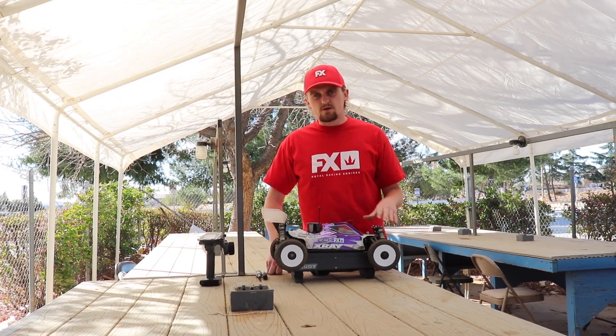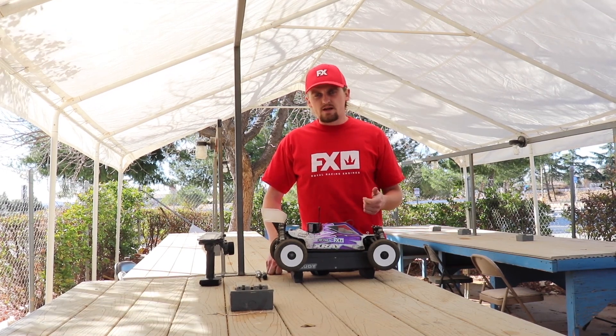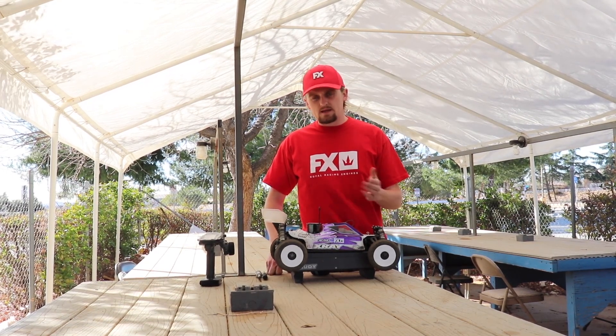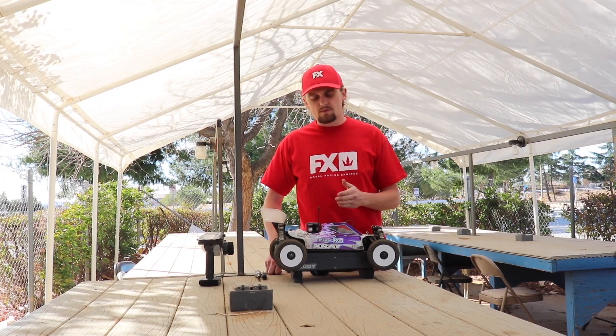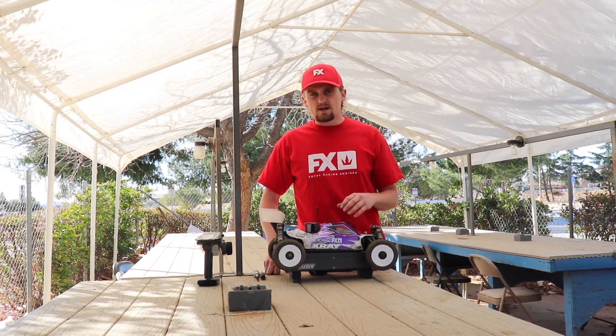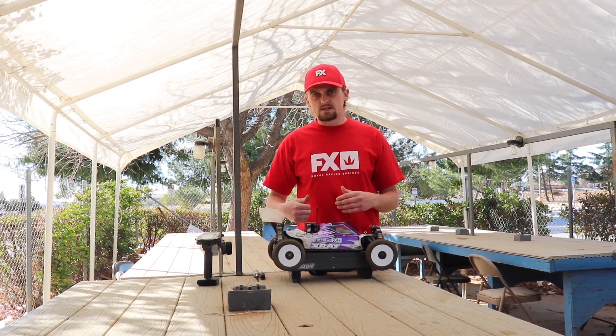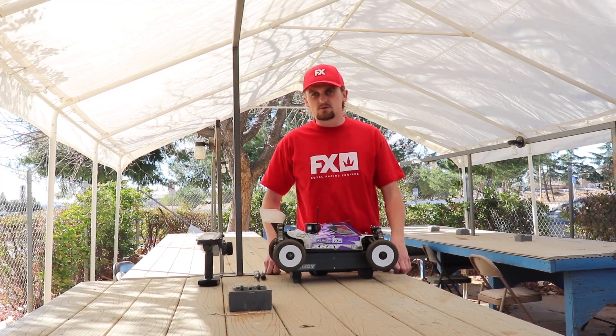Hopefully you can hear the difference from when I started to when I ended with the low end. You can see it cleared out a lot faster as I leaned it up, and again I'm only doing one notch at a time — make sure you do little increments as you go, just kind of creep up on it. Even at the start you saw it died. Try to refrain from turning the idle up because most of the time it's just the low end that needs to be leaner. You can see it stayed running and got better towards the end.